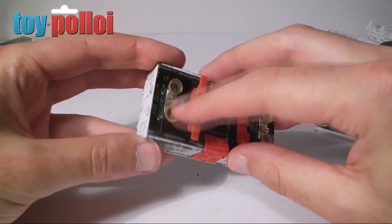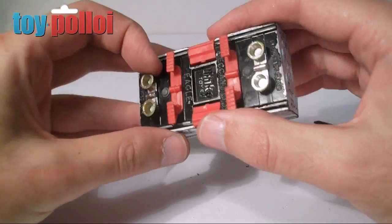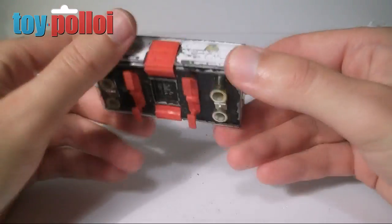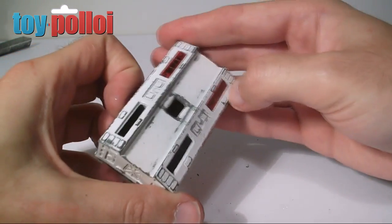Again, it has on it these small plastic jets, which will be held on in the same way as the ones on the landing gear. So you just need to squeeze the inside of those and they'll pop out, likewise these small landing legs. So let's go and drill out these rivets, and it will be ready for paint removal.